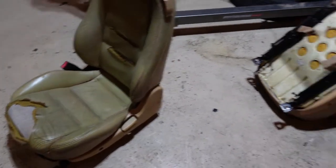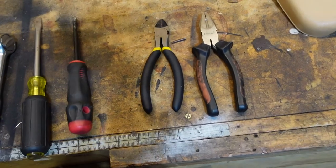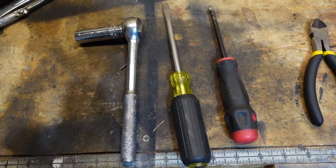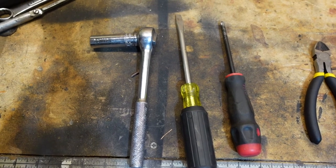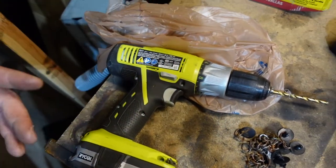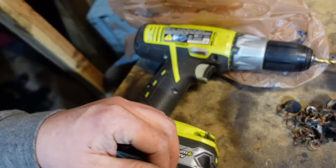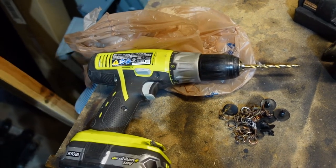Now we've got both of them out, it's time to start recovering. For the tools you're going to need: some pliers, maybe some dykes if you need them — those are going to be needed to get the metal rings on and off. You're going to need a Phillips and a flathead screwdriver — a Phillips to get the seat lever and panel off, and a flathead to maybe get the little plastic plugs off. You'll also need a socket. I used a drill because where the old seats had pre-made cuts where you could attach the rings, the new ones didn't, so I had to drill them. You can use whatever you want to punch it out; the drill worked just fine for me.